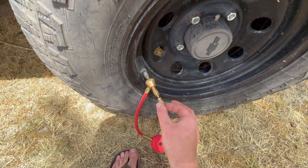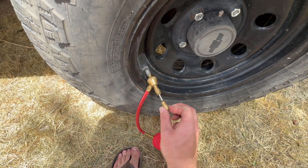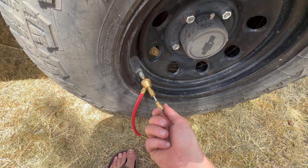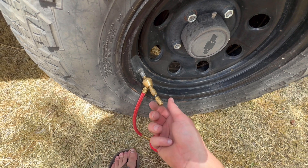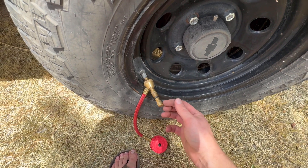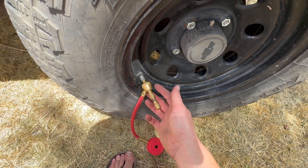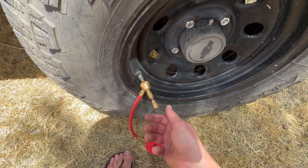Your outer plunger — because this does move in and out — this is actually what's going to remove the valve core of your tire. The best way I find to do this is just kind of push it in and then spin it with some pressure in. You can see it move forward more — that means we got the actual valve core. There we go, we're getting somewhere.